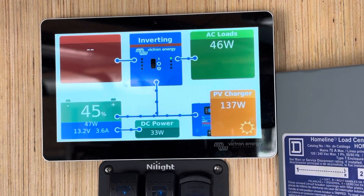If it's nighttime, crank on the generator, let it get some juice in — or shore power — and then when it gets back up to about 80%, turn it off if you're on generator, because the last 80% to 100% takes a long time, just like on your lithium battery in your phone.